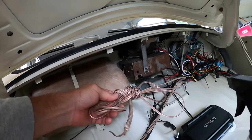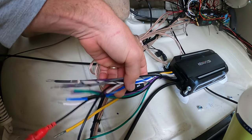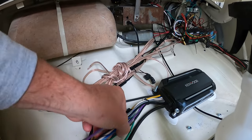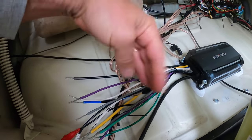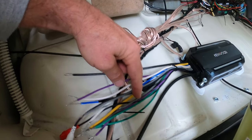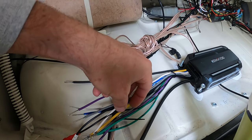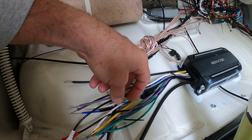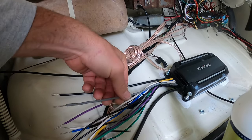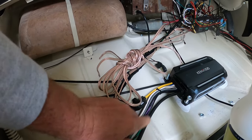I have to connect the remaining wires to some combination of the purple, green, and blue striped wires. I'm not going to use the RCA inputs. The ones I'm not using I'll cut at a reasonable length in case I need them later, and I'll put my extra headliner bow caps over them as rubber end caps, then tape everything with electrical tape and zip-tie the bundle.